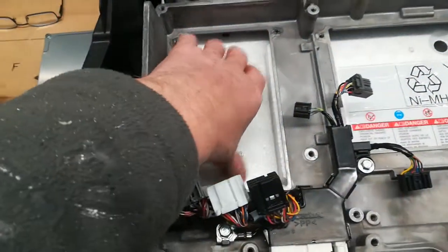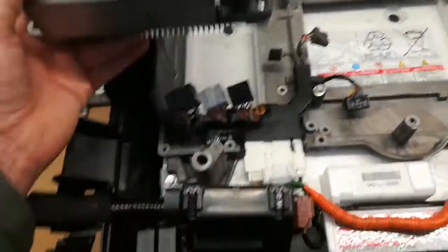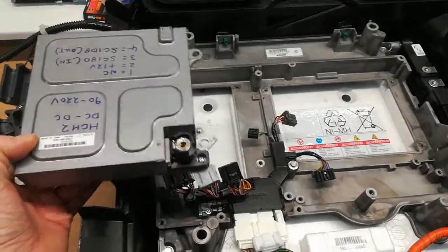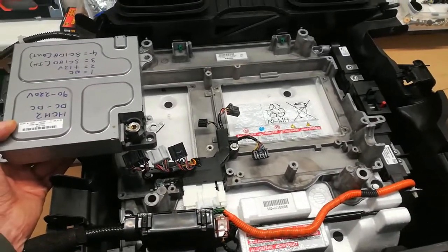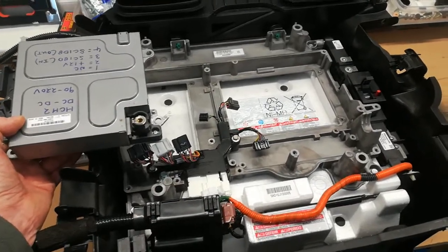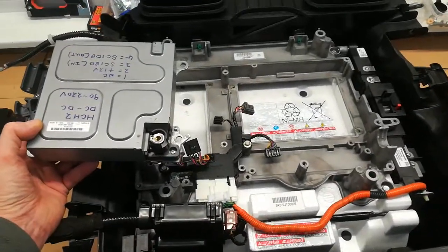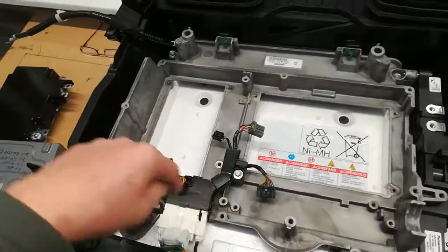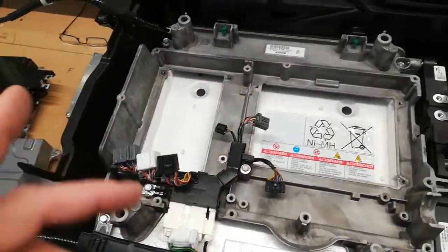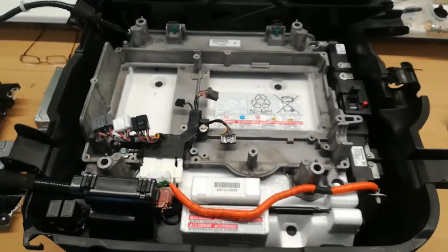This is protected by its own temperature sensors so it will shut down if it gets too hot, but we're going to lose about a third of the heat sinking. It's all within a nice efficient unit and I've never noticed a problem with the DC to DC overheating before. Certainly for initial testing I'm just going to hack the wires in and wire it up — the question is does the car accept it. It looks like it probably will, and as we've seen it works up to a much higher voltage, up to 220 volts. These are ten a penny in the scrapyard with loads of Honda Civic HCH2 models around. If it does accept it, we take the pack out, machine the surroundings, machine the DC to DC, fit it in properly, and then we're basically ready to go with further increases in pack voltage to get more power.